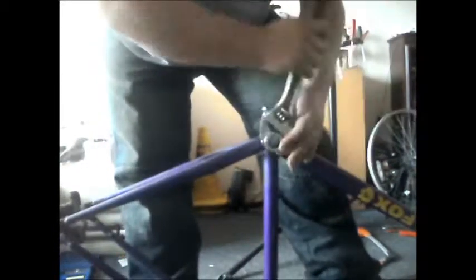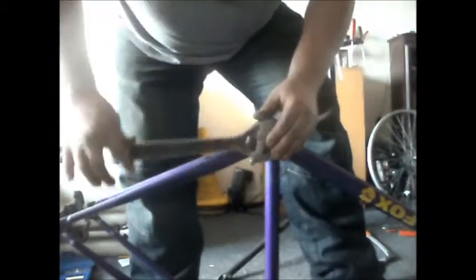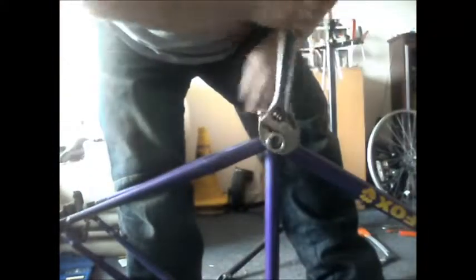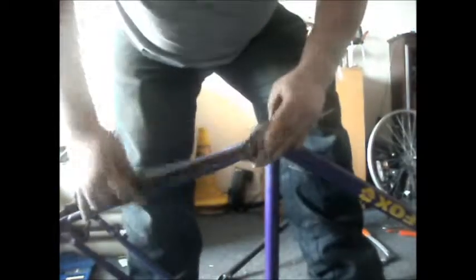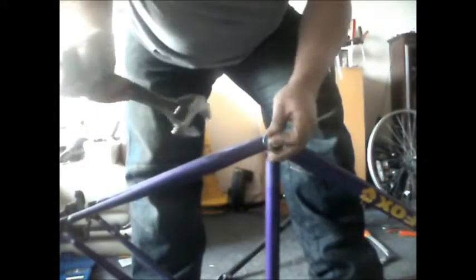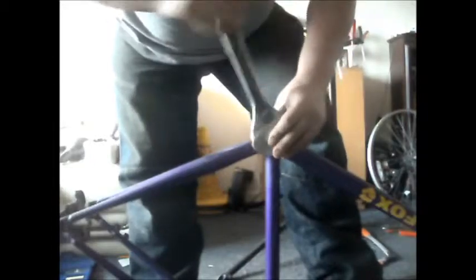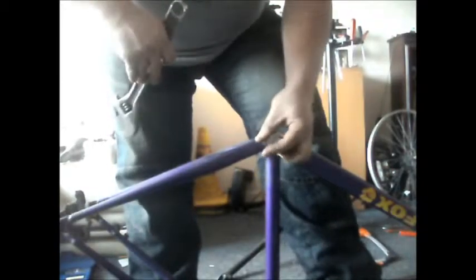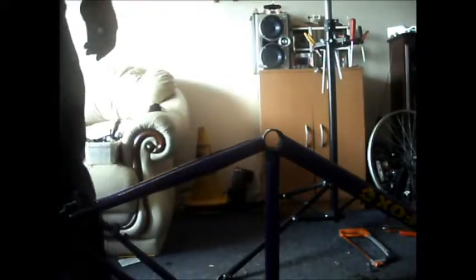Some of these cups can be metal on these sealed bottom brackets. I'm not going to reuse this one anyway because it's beyond repair, but I do have another one about somewhere. Come on, unscrew. That is probably the easiest way to get a bottom bracket out. You could use one of these little sockets which I've got, and a long ratchet or a cheater bar. But as you can see, my very old monkey wrench does the trick. Yeah, that's a plastic cap — they all go in the bin.